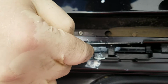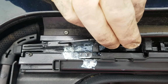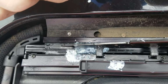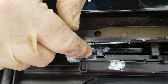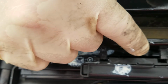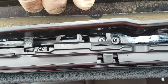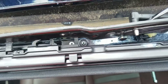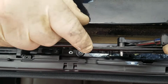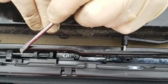The next thing is there's a screw here, and you pull this apart to move the trough guide out of the way, and there's another screw right there. That's a number 2 Phillips. You take that off. I usually take a pair of needle nose, pull this off, set it to the side. That allows this to move. Once this moves freely, we're going to pop this trough, come up over higher. We're going to pop this trough loose, and you just take a screwdriver, you can use a pair of pliers, wedge it in here, pop that loose, and it's out of the way. Done. Because remember, we're replacing this arm.